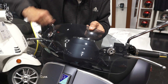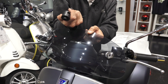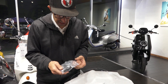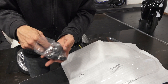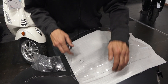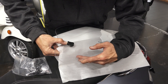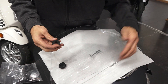Remove the pair of screws. You're going to have plastic spacers and the metal piece that will want to fall out — get those all out of the way. Included with your windshield kit is a hardware kit, pretty much the same style hardware as the original fly screen. Take the two rubber grommets and carefully install them into the two holes on the windscreen. Just work the rubber grommet all the way around using your finger — don't use a sharp tool like a screwdriver.